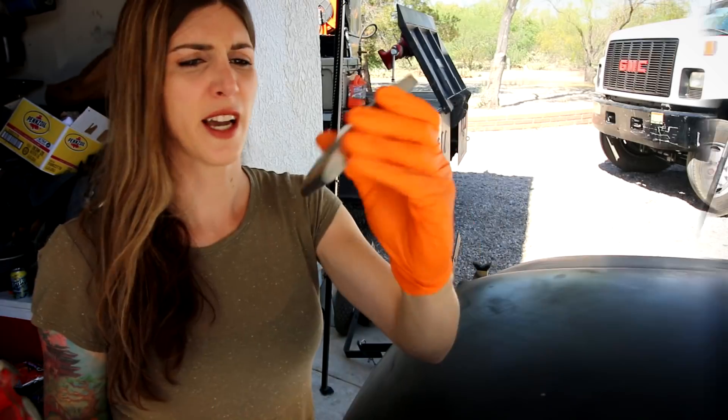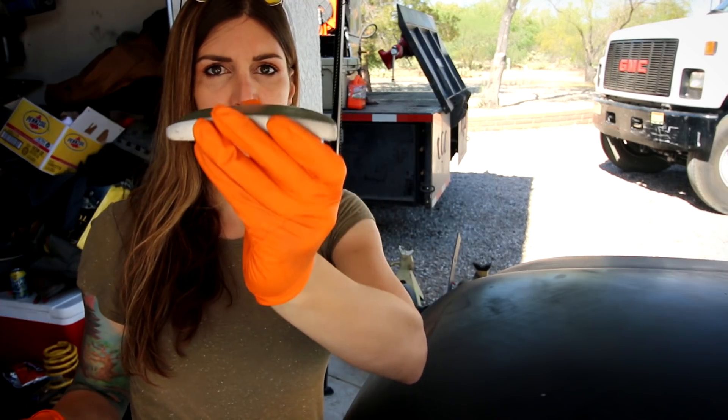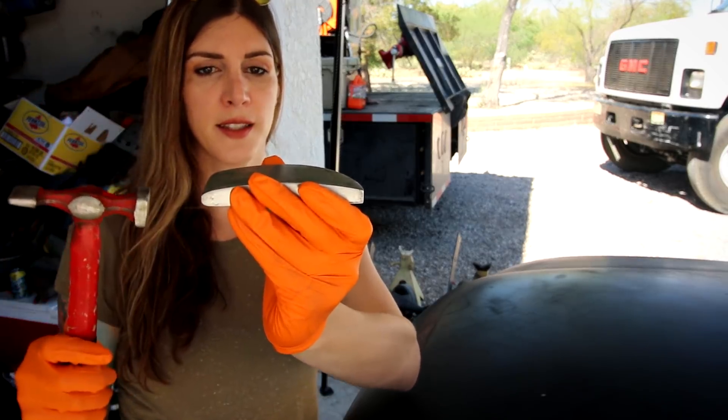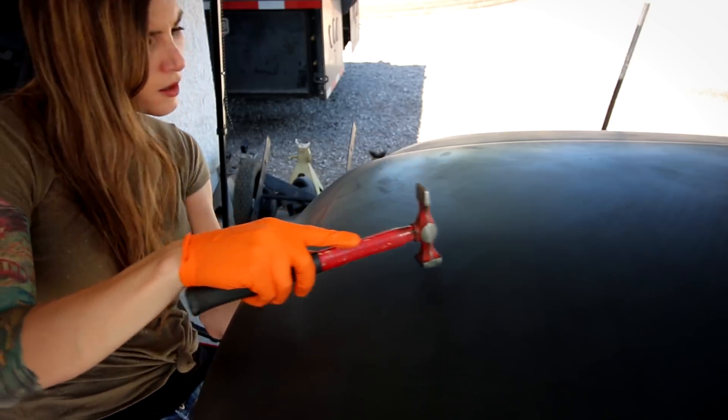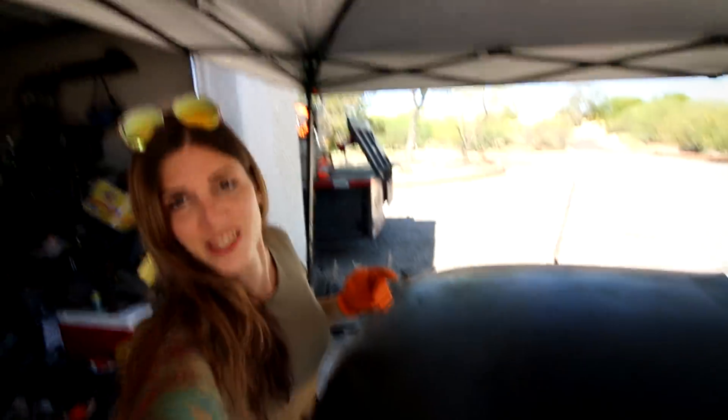It's like a hash brown from space - the space hash brown - and a little metal hammer. Basically, I'm going to stick this under the hood and this above it and just lightly tap on the outer perimeter of where the upwards dent is. Right here in the very front, that part of the high spot is gone. The only part sticking up now is the back left corner of it, so I'm just going to tap it out and then I'll be ready to put the body filler on there.